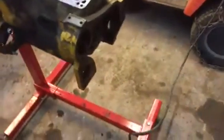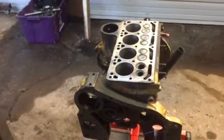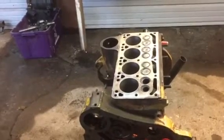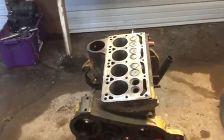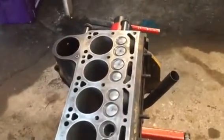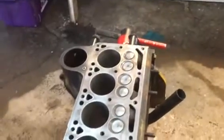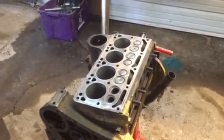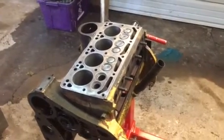As the day goes on today I'll quickly finish grinding these other two valve seats. Today in southwest Wisconsin it's actually above freezing outside, so after I get the rest of the valve seats ground I'll pull all the valves out. I should be able to wheel this engine outside in front of the shop and give it a really good bath this afternoon. First I'll degrease the outside, then get some hot water and Tide laundry detergent and give it a good scrubbing, get everything all nice and clean, then bring it back inside, dry it off with compressed air, and either bag it so it doesn't get dirty or I'll start assembling it this afternoon. So that's where we are so far and I will post more updates.